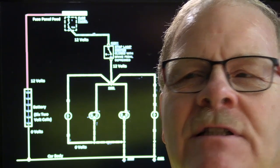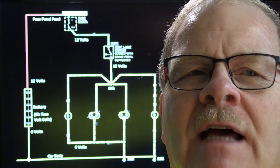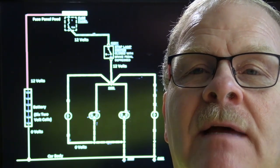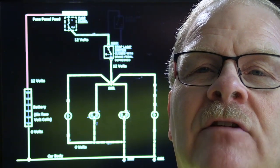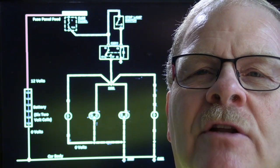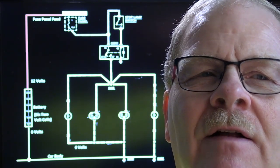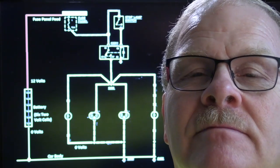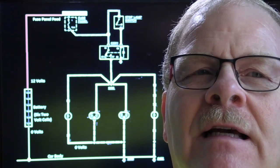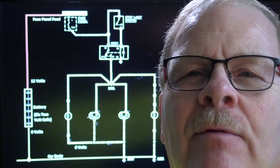Ford eventually came out with a replacement stoplight switch. It was odd to me that this was an F-53 chassis and the stoplight switch was actually put on there by the motorhome people, and it was like a Chevy stoplight switch. So this is what I did to fix it — I actually put a relay in there and fixed it so that the stoplight switch closed the relay, and the relay carried the load of the lights. I would take these little Ford 30-amp green fuel pump relays from the old Ford systems, and the parts house had the relay and the pigtail in stock.